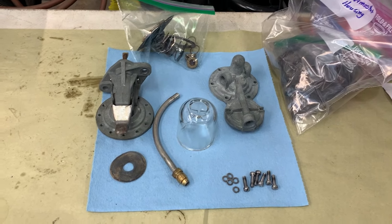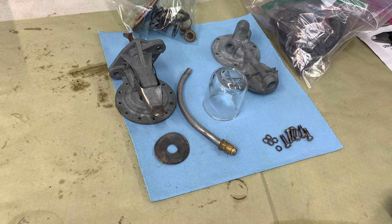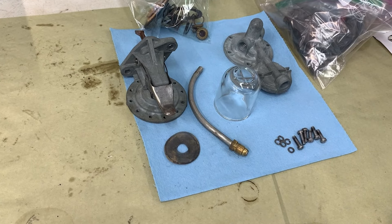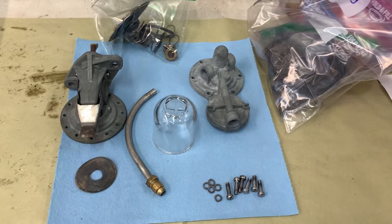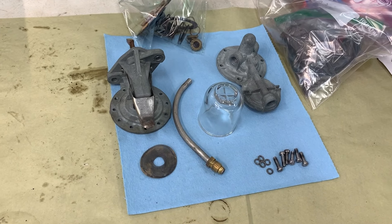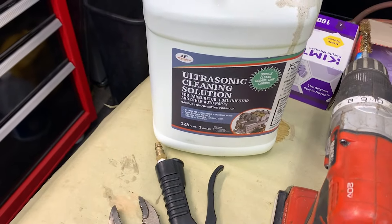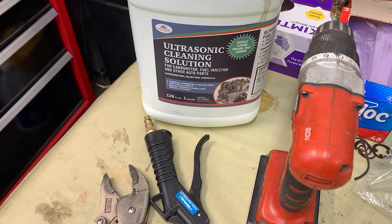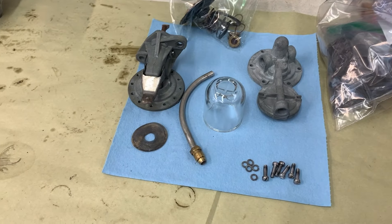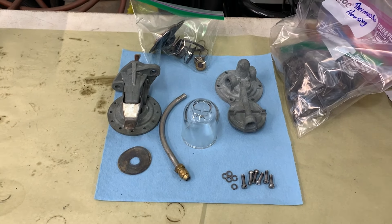That's what not much elbow grease — mostly done by the Sonicator. I watched them sit for a few minutes in vinegar, and that helped break up some of the hard deposits from corrosion of that metal. That cleaned up okay. Then I just used this ultrasonic cleaning solution — you dilute it one to five and it starts off a nice clear green color, then gets darker and darker as it starts to pull stuff up. All ready to go, waiting for the rebuild kit. I'll call that a job — 90% done.